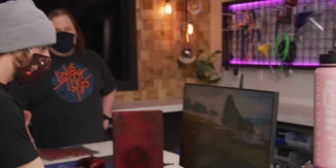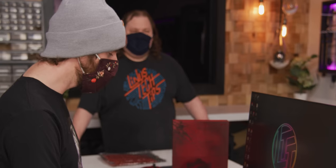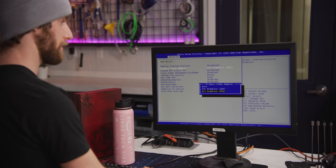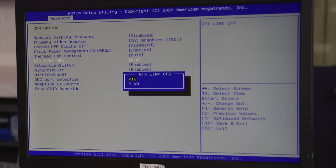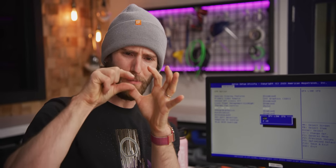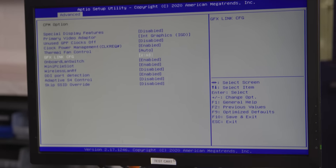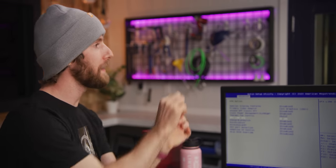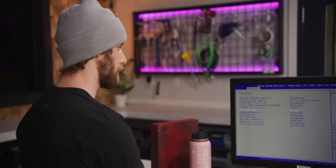Just like that. And was installing Windows on it simple? Yeah, it just ran. Really? Yep. Primary video adapter: integrated graphics. It supports external graphics, which is weird. You can actually bifurcate the internal PCI Express link between the CPU and GPU on the SoC into two 8X links. That's probably for the other board revision that has two M.2s — to share lanes or something. RX 8120? A9-9820? The RX 8120, from what I can tell, runs at the same clock speeds as the Xbox One S. The A9-9820 is higher — about 2.35 GHz versus 1.75 GHz.